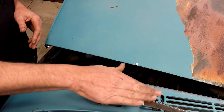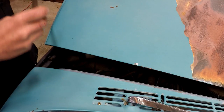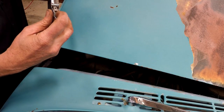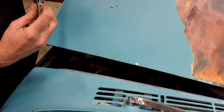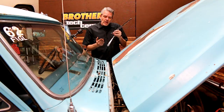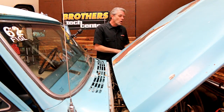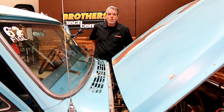When you're taking off your windshield wiper, you want to know that there is a little tab right here. It's hard to see and a lot of times you miss it, and that's the reason you can't get these off. That little tab has to be moved back before you can pull off your wiper arm.